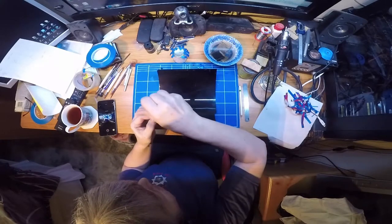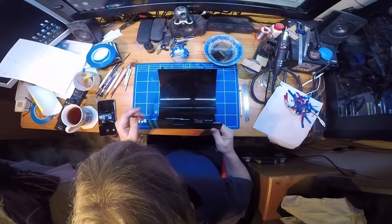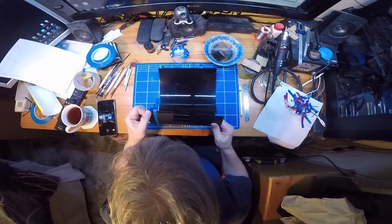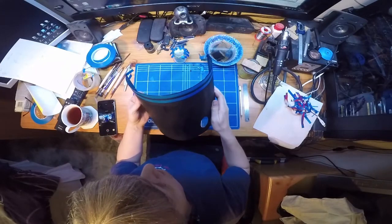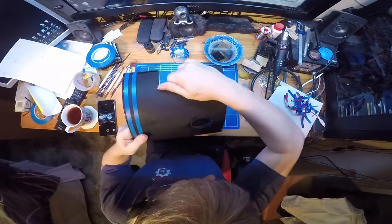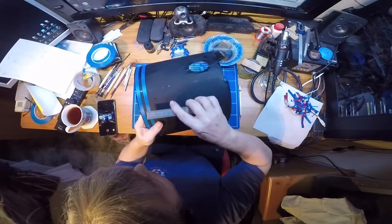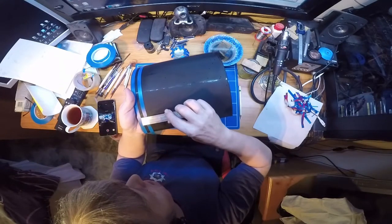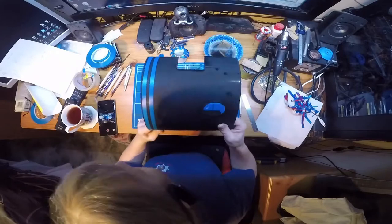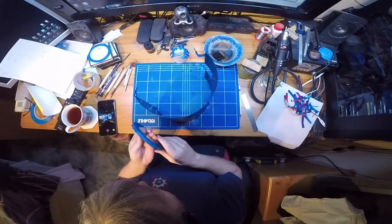Now just create a tail on the end, so when I'm taking this stuff off, I don't get covered in paint. This is easy doing straight lines, it's when you do fancy curves and what have you. So, quick recheck, 7mm, 7mm, 7mm, perfect. Right, and back to the single.